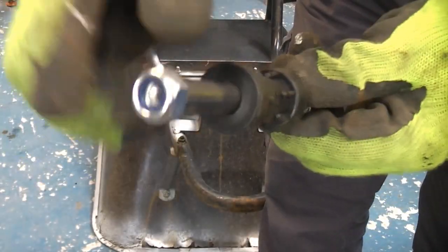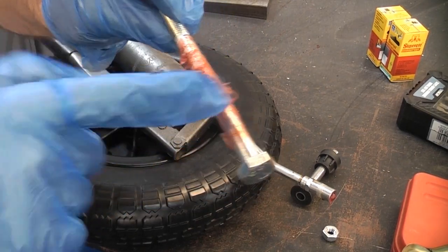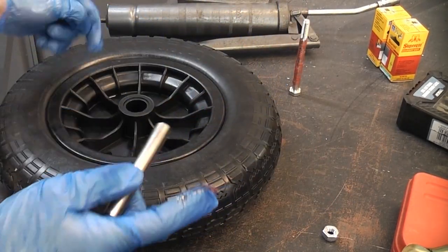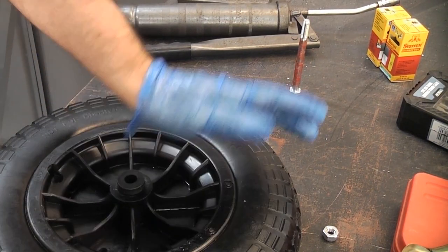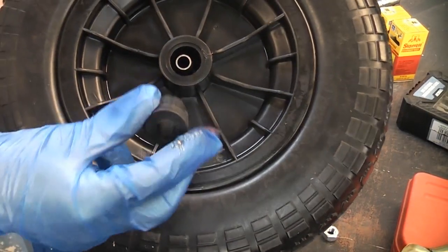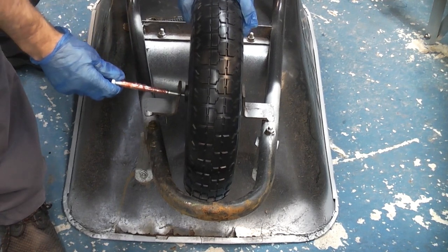The new one is much better quality — we've actually got a nylock nut on the end. I'm going to remove that and put a bit of grease on there before we put this back together. I'll take the axle and build this up — push one of the bearings into that end, put the axle in, push the other bearing into the other end. Then I'll take the wheel, put it back, and push the bolt through.